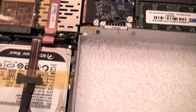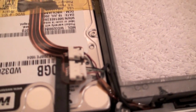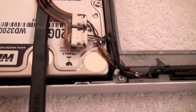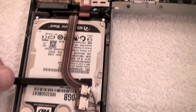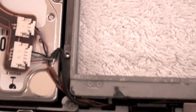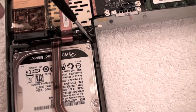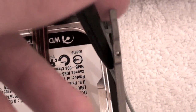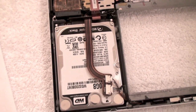The next step is to carefully disconnect the hard drive cable from the logic board. You can see that it travels down and connects into the Serial ATA connection here. Very carefully take the spudger and remove this ribbon that's on top of the hard drive — just pry it off very carefully, because you're going to be sticking it on the new drive. Now that this ribbon is up, we are going to be removing two more screws that hold in the hard drive bay. Then all you have to do is take out this hard drive restraining bracket and save it away somewhere.